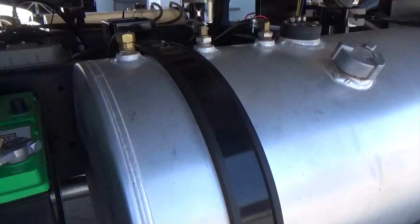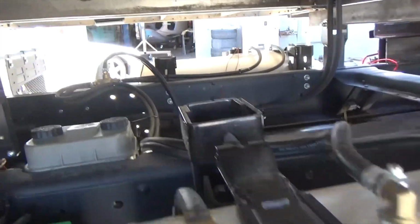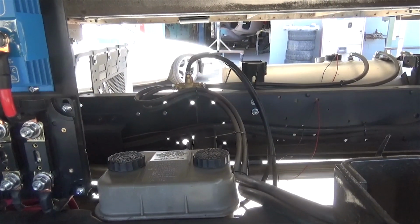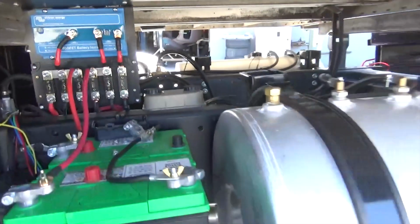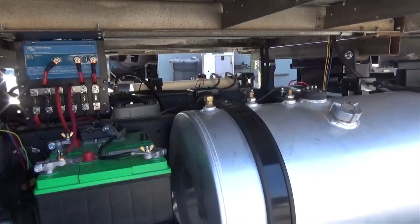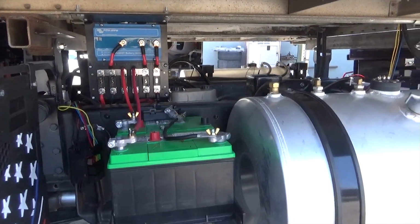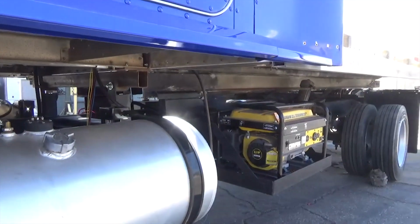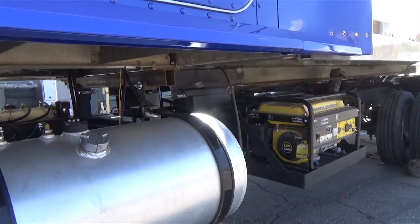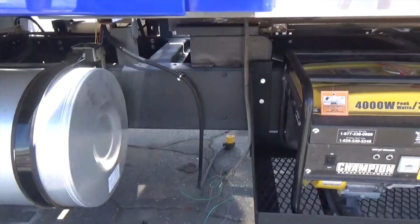We have our other tank here. As you can see, they have two lines plus a vent, and also our valve has two lines, so it can actually send the return fuel back to the same tank it's drawing from, which is pretty cool. I didn't want to mess with an electric valve. Manual valves just seem a lot better with all the experience I have of electric valves not working. Probably because I owned a bunch of square body Chevys, but might be different on a different truck.